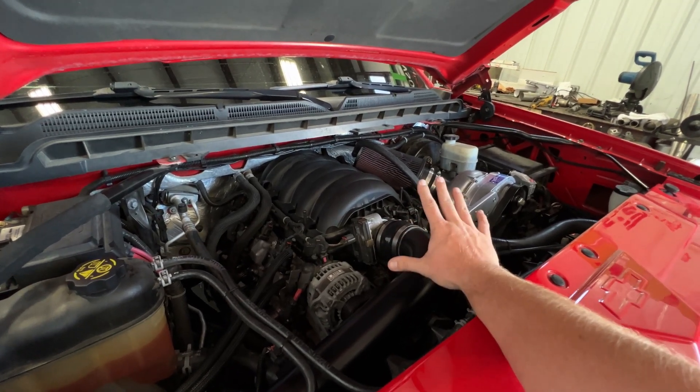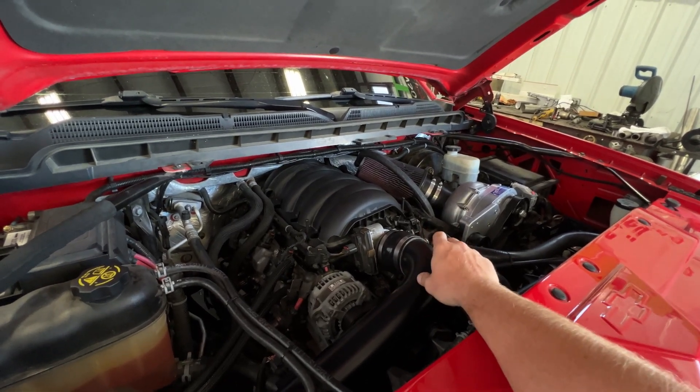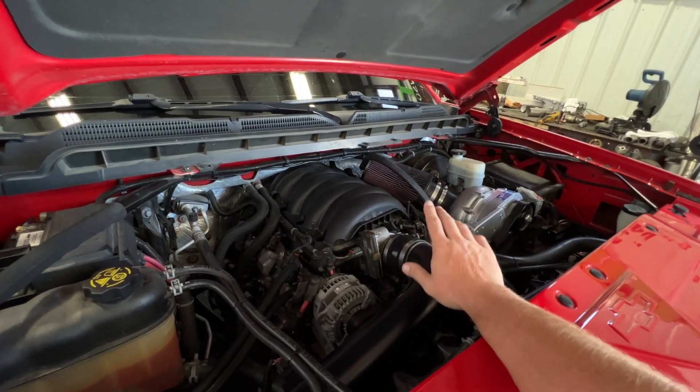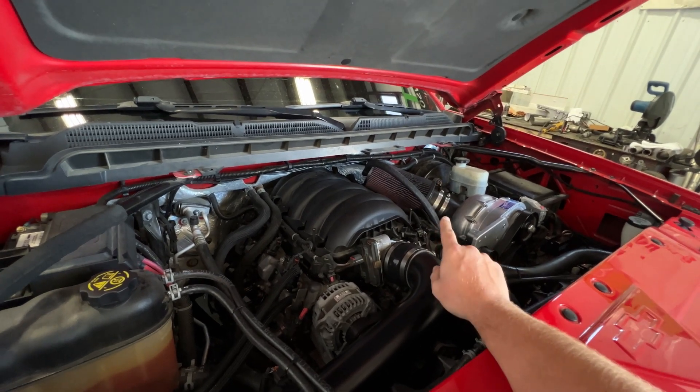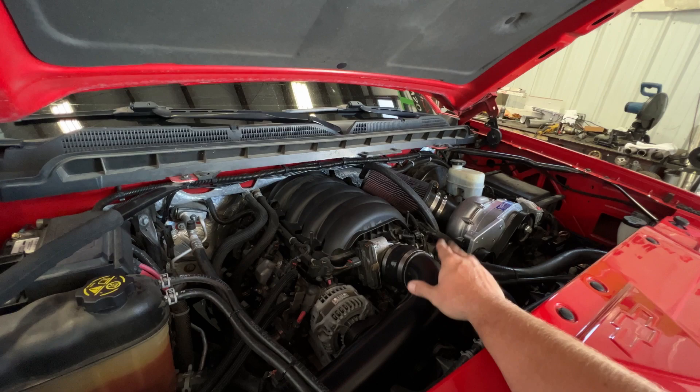Is it correct? No. It does work, but it is not correct. What it's going to cause is — obviously you want your ECU to comprehend boost — so we want to have our two and a half bar, three bar, whatever you want to consider. It's actually a two and a half bar MAP sensor.